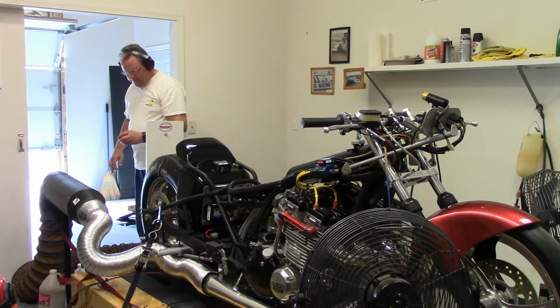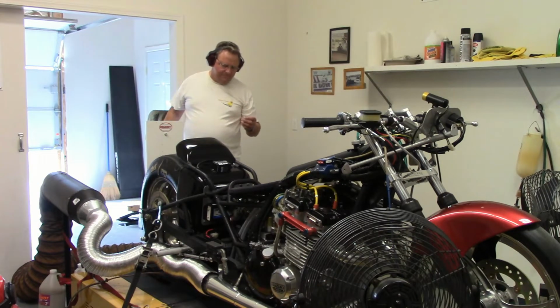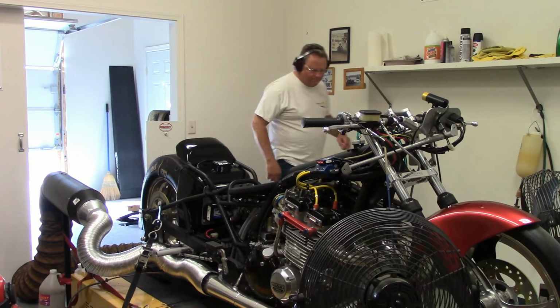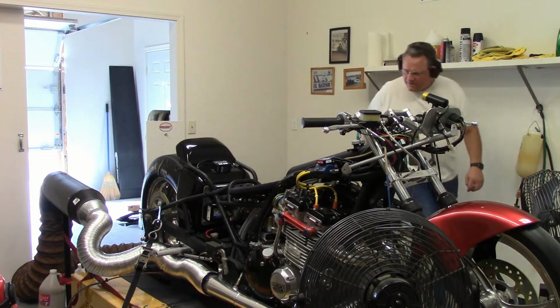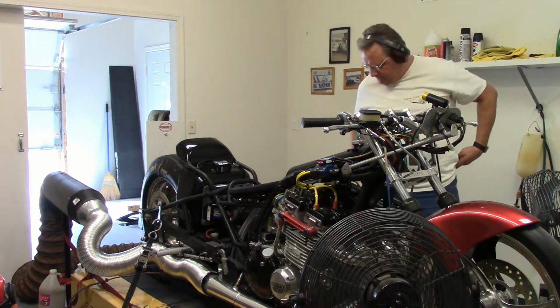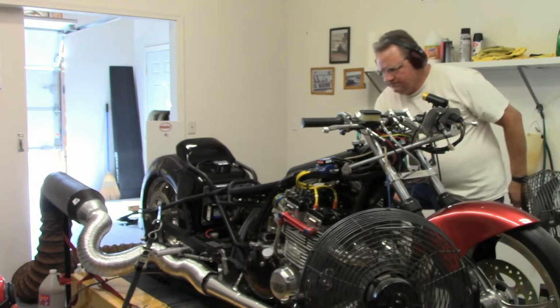So what I did is I retarded the little shift plate on the case about 1/16 of an inch rotation. Now it can still preload and come off the pin, but when it falls into each gear, it goes onto the pin and doesn't overshift, and it's staying running in second. It's not killing in any gear, and when I'm in fifth and push on it hard, just cruising, it doesn't kill it.